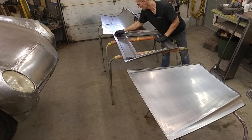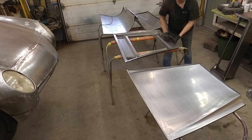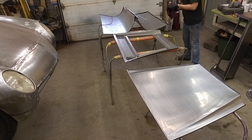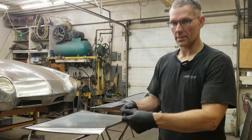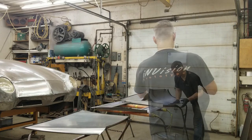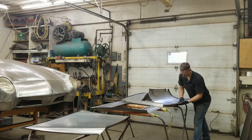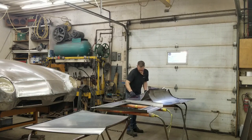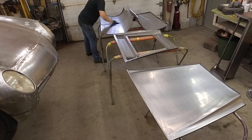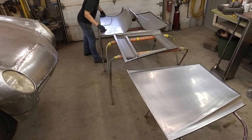Everything's been welded, prepped, ground and smoothed out. Nobody's ever going to see this in here, but until we get it covered up it still has to look nice. That's all oil and grease — you've got to make sure you keep turning the rag, because otherwise you just keep rubbing the grease into itself. All the coatings removed from these panels, they're going to start oxidizing if it's too humid. That's why we never spray when it's humid — let the humidity go down and then go ahead and shoot these panels.